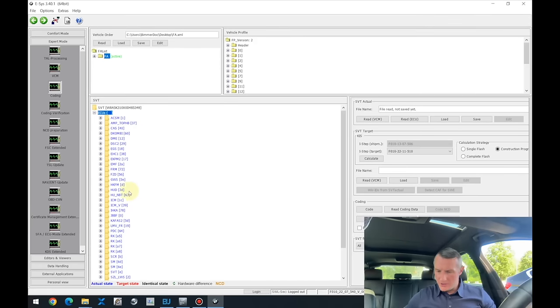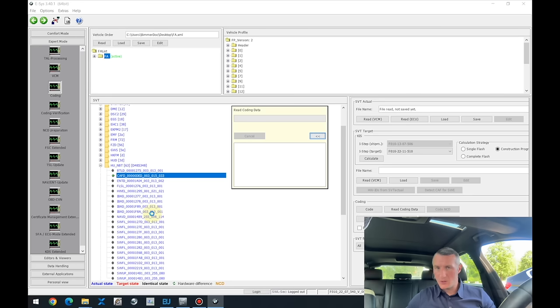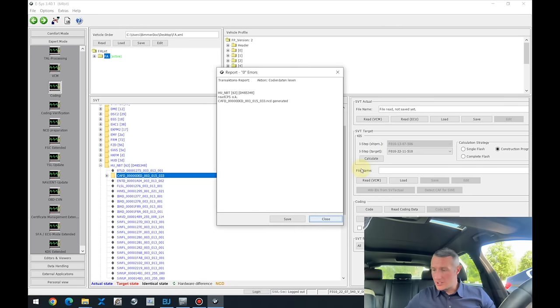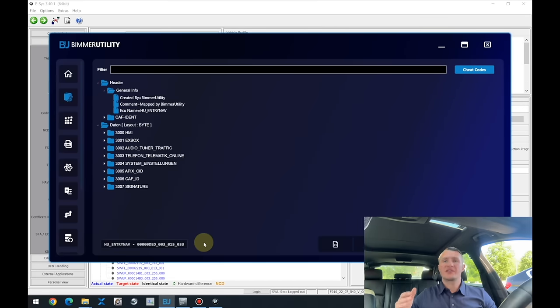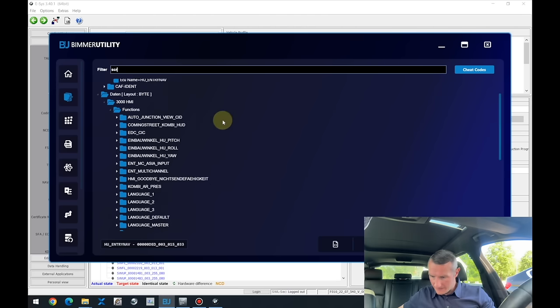One more thing we need to do in the Esys, actually in the head unit: if you have a car with AdBlue, you will see that kind of sign. It tells you in the head unit about the SCR system, and it shows the counter for when you have to refill it and all that stuff. So proper AdBlue removal also requires that parameter to be deactivated.